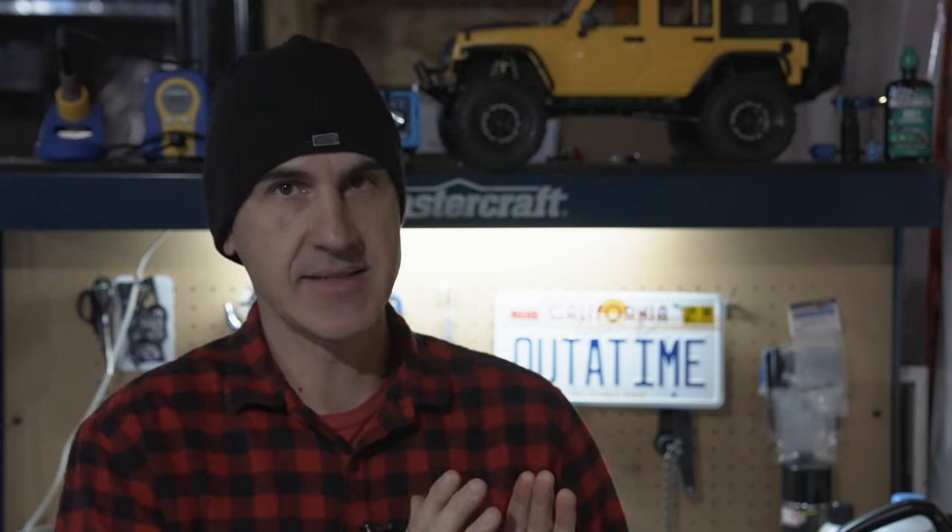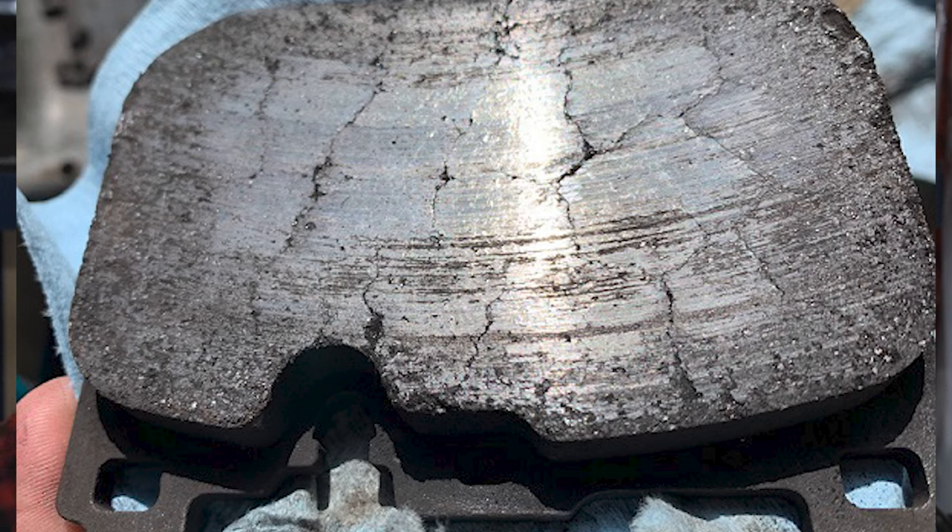Now that doesn't mean you can go down a hill like this one riding your brakes the whole way down, because you're actually going to have an even worse problem: glazing. The way your brake system really works is it relies on two different types of metal offering friction. When your brake system gets glazed — both your rotor and your brake pad — both surfaces become smooth like glass and you lose that required friction, making your brakes even worse. The difference between glazing and brake fade is brake fade goes away when your system cools down. A glazed rotor could actually need resurfacing, and in many cases your pads are shot and can actually shatter and disintegrate.